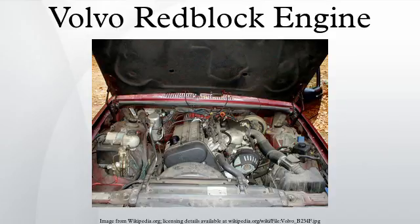The B17 was a special version for certain European export markets, with a shorter stroke than the B19: 88.9 mm bore and 71.85 mm stroke for 1784 cc displacement. The B19 Turbo was the 1986 cc, 136 PS B19 ET, sold in certain markets where engines of over 2-litre displacement were heavily taxed, such as Italy.